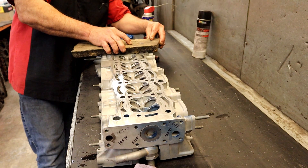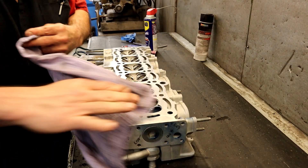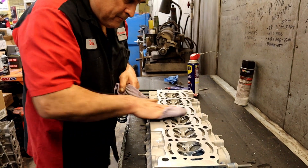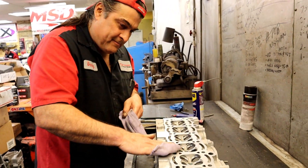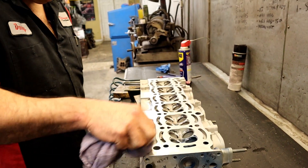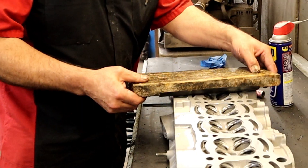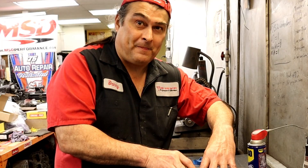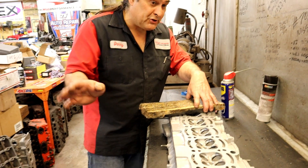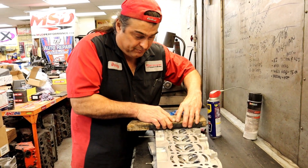Using a flat piece of granite with 400 grit and WD-40, they're taking any imperfection and bringing it to the next level - without sitting there sanding aggressively. Faye shares a story: an old mechanic resurfaced the cylinder head on her Volkswagen on a belt sander - wet - and the car is still running. There's nothing wrong with a belt sander; it's the user. You can butcher a head with one, or do as fine a job as a CBN. It's an art.